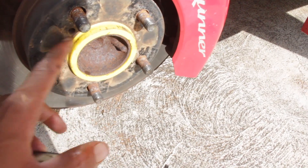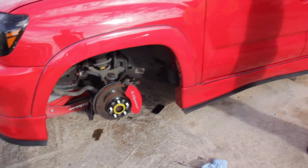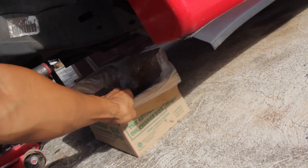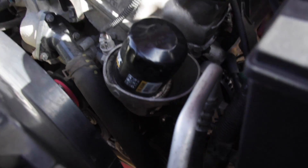Oil is draining now. We just gotta get this yellow ring off — that's a pain. Then we put on the spacers. Quick little tip for you guys that have this silver oil catcher: make sure that the black plug underneath is in there. There's a hole for all the oil that gets caught to drain out — make sure the black plug is in there, if not it's gonna get all over your engine.